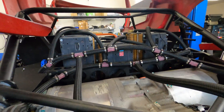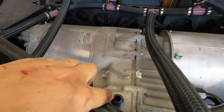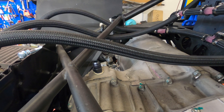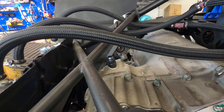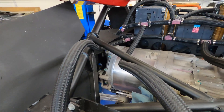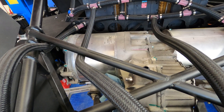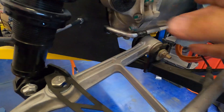That's something I came up with myself. Up here there's also an overflow system — if too much fluid gets pumped up to the reservoir, it overflows and goes back to the top of the transmission. The reservoir will also be vented, and that vent serves as the vent for the entire drive unit. So that's how I've modified this thing.